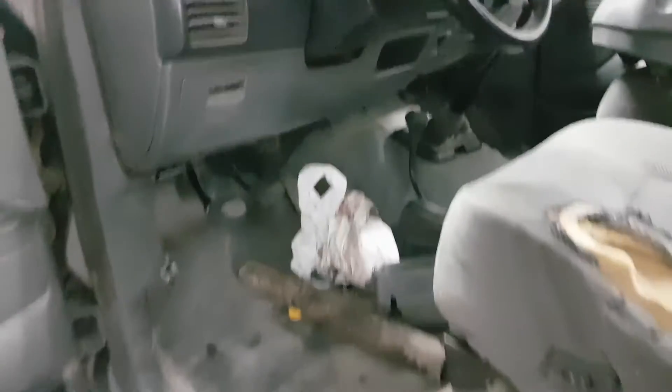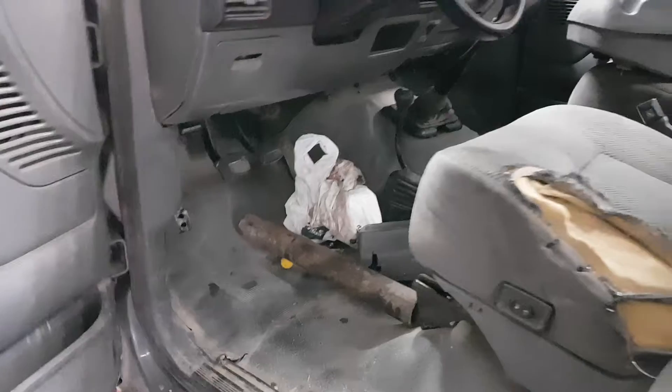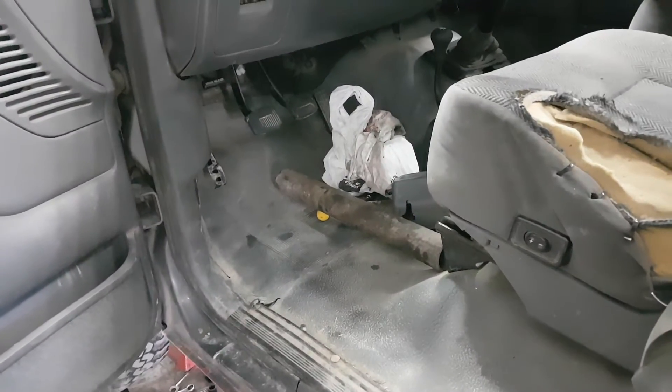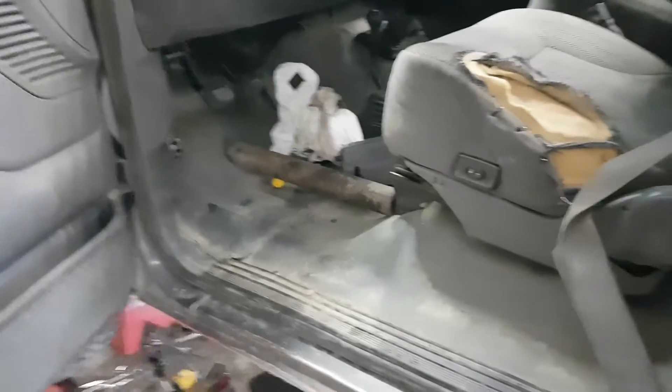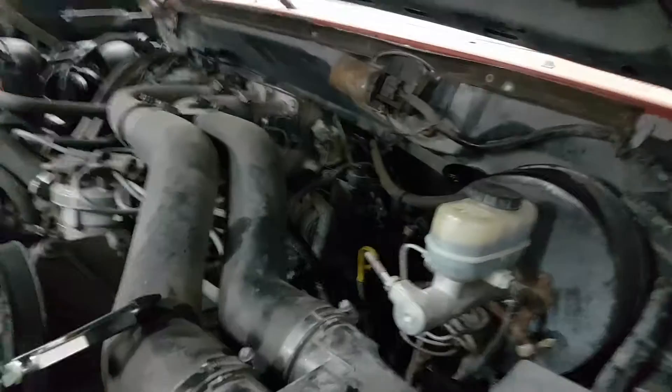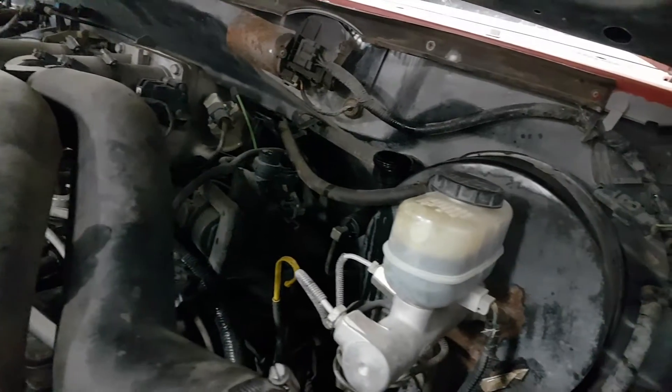You can bleed these clutches by yourself too, just by shoving something up against the pedal and depressing it. You don't need two people to do this — I don't know why everyone says that. You just shove it in there, wedge it in, and use the cushion of the seat to add spring to your pedal. You don't need two people. That whole process was pretty awful — two hours screwing around with that stupid slave cylinder — but it's done.